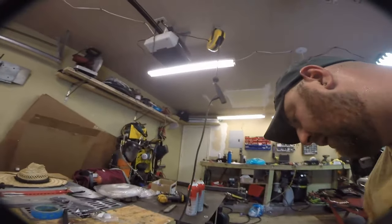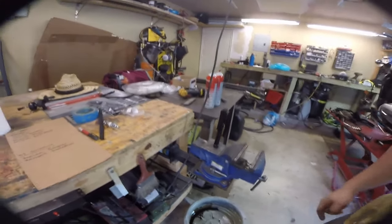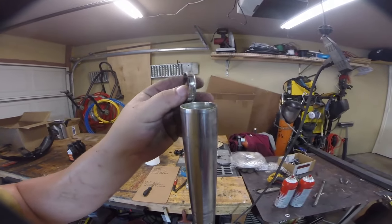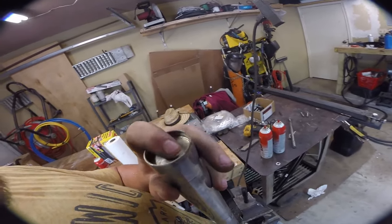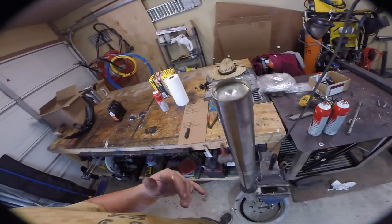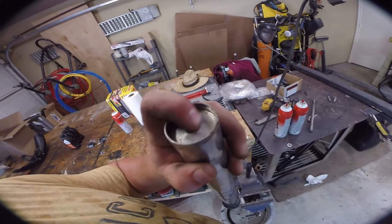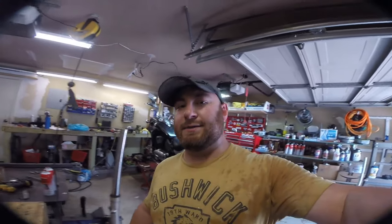You'll need somewhere to drain your oil into — this always makes a mess. It's a lot easier if you have a hard mount like a vise and a rag to hold the fork while you're working on it. There's a plastic decorative cover — just pop that off with a sharpened screwdriver. Inside there's a center dip: you apply pressure, which lowers the cap down and exposes a snap ring, and then you push the snap ring out — carefully, so it doesn't shoot across the garage.